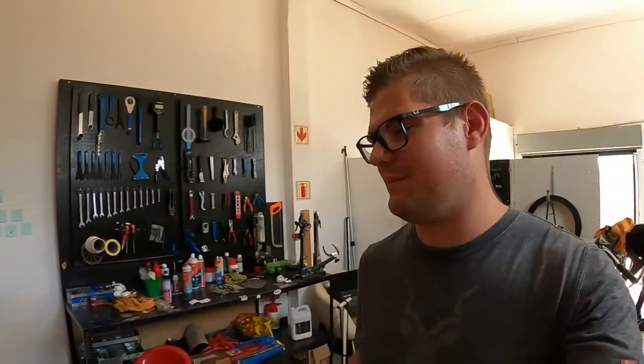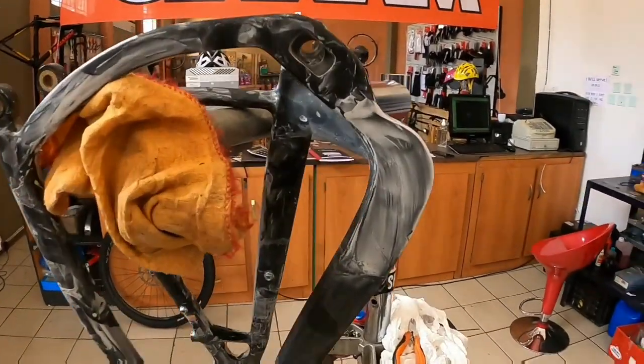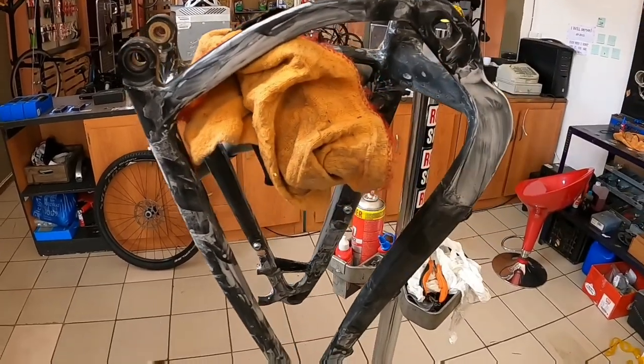Alright guys, we are back on the carbon frame that we've prepared — if you don't know about this, go check out the videos. We've been sanding quite a lot and I'm doing this between work. Now, there are a few things that make a massive difference. I thought it was super expensive but the silicon carbide waterproof abrasive paper — water sanding paper — makes a massive difference when sanding your frame. It leaves it super smooth and you can just wash off all the clear lacquer residue afterwards.